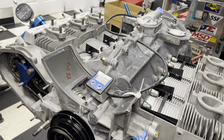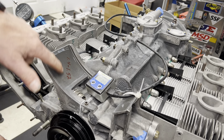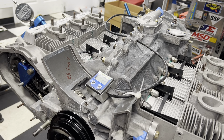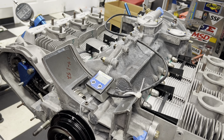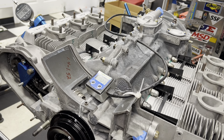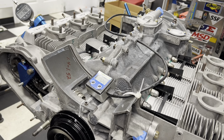What's really cool about the DigiDix, whether you're finding TDC or not, is it gives you an idea of how far you need to change the cam. I'm going to split the difference here, so we're going to go to about 148. Looking at the gauge, we land at 1.46 — call it 1.46. So we need to move the crank in relation to the camshaft 12.6 degrees.